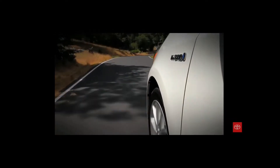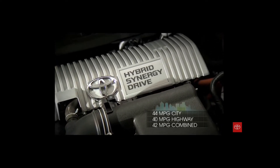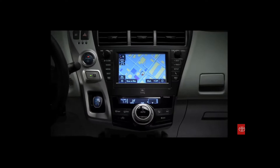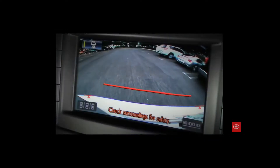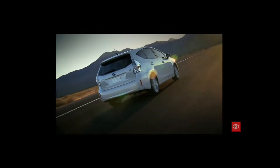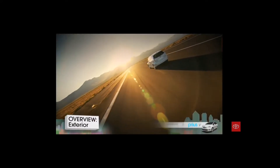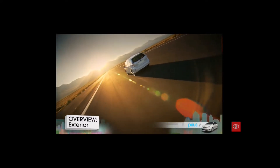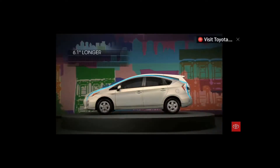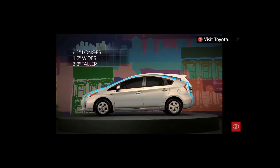It has exceeded all my expectations. I was given the opportunity to swap out the aging nickel metal hydride battery. When I say aging, I'm not talking about it actually failing — after running a test with the Dr. Prius app, the life expectancy percentage was 63%, doing pretty good for eight years old. Aging in the technology sense. Nickel metal hydride has been around for a very long time and it's very trusted. I get that. However, it is time for a fresh face.